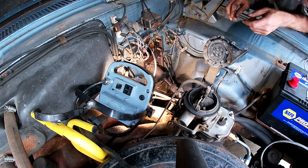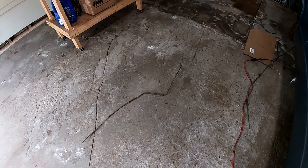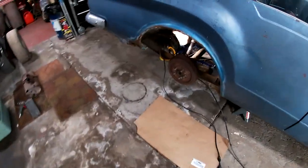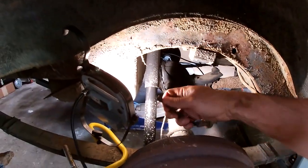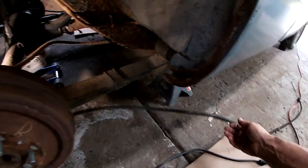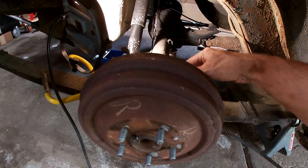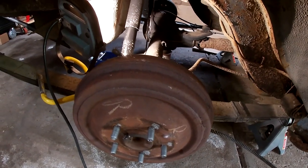Want to address that? So there's my rear brake line. I'll use that as a template. It's going to be a little longer because it has to come up to the proportioning valve. But new plan: because both these original rear e-brake cables work, I'll take these Barracuda ones off and get these mounted inside, which I think I'll have to take off the shoes and everything.